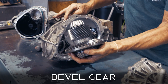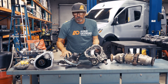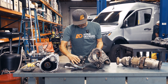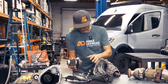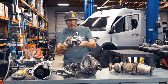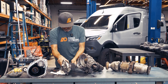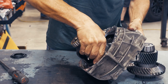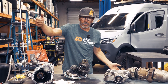Here's our bevel gear. The bevel gear is taking our input from the transfer case into this gear here, transferring it into this gear. Some people might think of this like a pinion gear — this is your ring gear — but it's actually a bevel gear. Just so you know, this is all welded together; this is not a serviceable part where we can change these components out. Basically this helical gear is then going to drive the helical gear on the differential. The differential sits slightly offset to it, and you can see where it's now driving the driver's side axle and then the longer one over here as it goes into the carrier. So from the bevel gear we're getting our drive, then it's turning the differential, and the differential is going out to the axles.